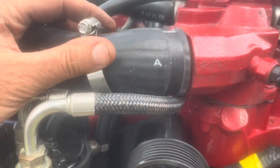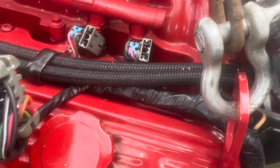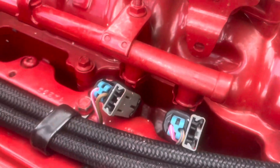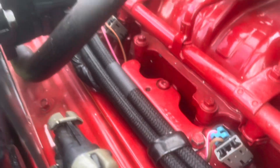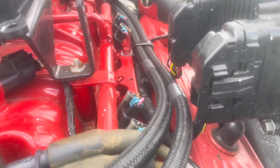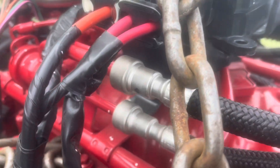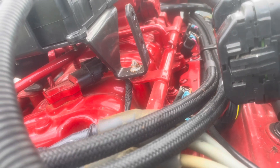Working towards cleaning up and getting the front of the motor apart. All these fuel lines run underneath that hose there and run down the side of the engine right through here, through that clamp there on the intake, and then they connect and run around to the back. There's a clamp to the intake — I think that's the only clamp. And then they come up with another clamp off this post and then go to the fuel rail. I've got to find my fuel rail tool to get that off.